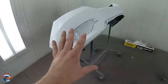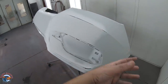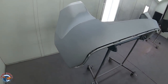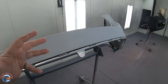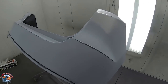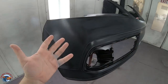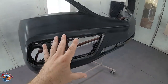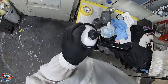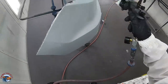Let me show you what I'm going to use it on. This is a Civic bumper that was getting a blend — I'll be able to cover and blend into this area and re-clear the whole thing. On my silver, since I have bodywork everywhere, I'm going to seal it all up. Silver metallic is going to want to go right into any stray sand scratches, so we want to make sure we have a good basis. We don't want to put base coat right over that — you want to seal it off first. Moving to the sealer, I'm going to be using my 1.2 fluid tip.